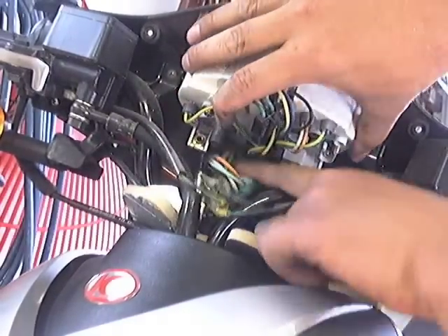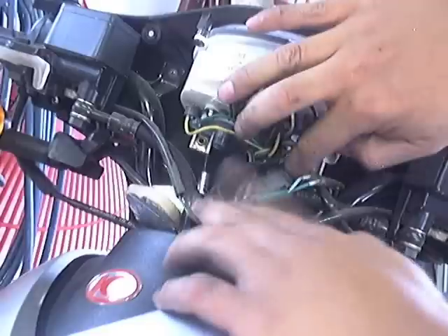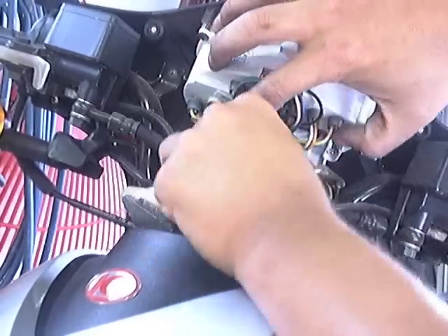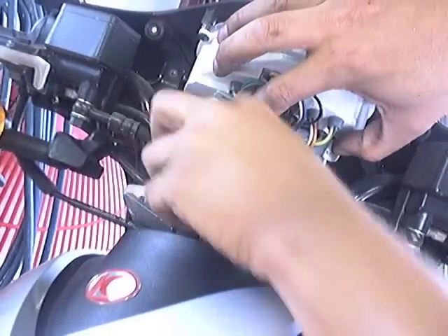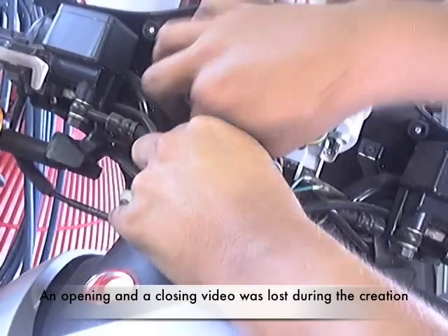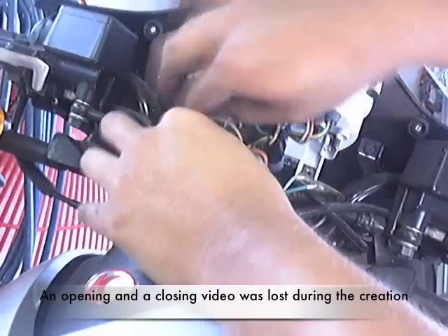I've taken this apart and got the camera in position. I took the front off and immediately saw the problem. As you remember the instrument panel and where it hooks up — you can see that's where it hooks up right there. And if you look down here at the bottom, you can see the cable. Basically, the cable rattled loose and came off. I thought the cable had actually snapped and ordered a new one, but that wasn't the issue. So I'm just going to pull this up in there and line it up — it's a little difficult.